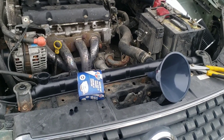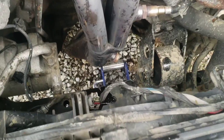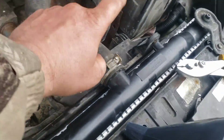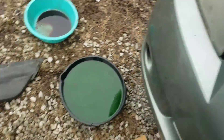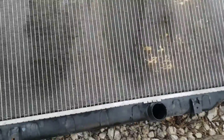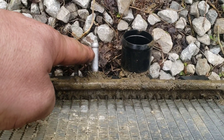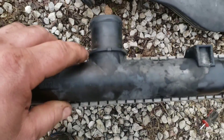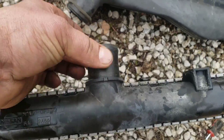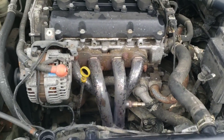I've got everything hooked back up as far as the radiator goes. I still need to put that intake track back on, but I've got my cooling fans plugged back in, top hose back on, bottom hose, the trans cooler lines, and mounting bolts. So I'm ready to fill it up. As far as putting those hoses back on — especially on these ones — you want that clip to be right behind that nipple so if it goes to slide off, it catches that and stops. You want the clamp right behind that. If you just pay attention to your lines, you'll see where the old ones were sitting before you took them off.